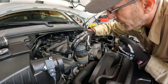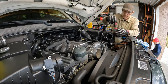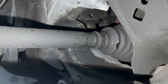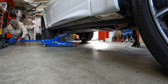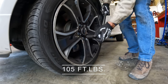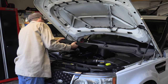I swapped out the oil filter cartridge - fairly straightforward. Quick tip: only go hand-tight on the plastic housing. I also bought fresh air filter elements and after getting approval from my helper went ahead and installed those even though the ones in there were in pretty good shape. Then I spot one leaky CV - a full-on hole in the boot. Passenger front CV boot goes on the list.